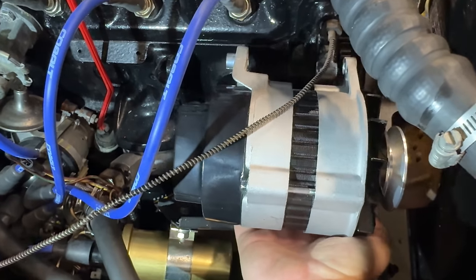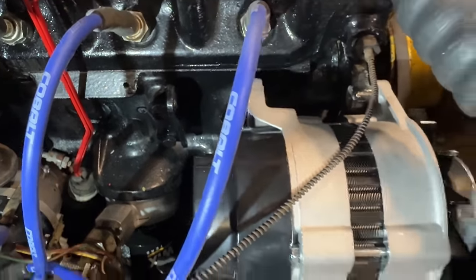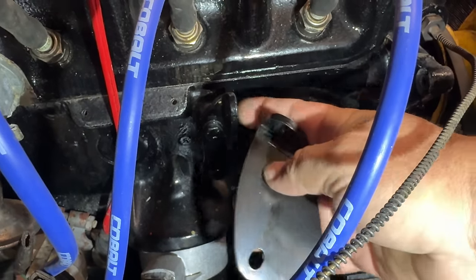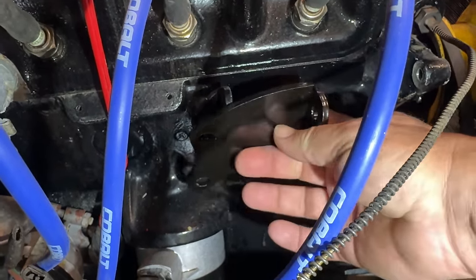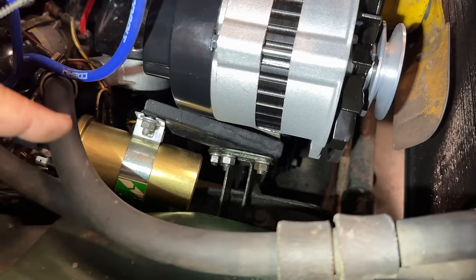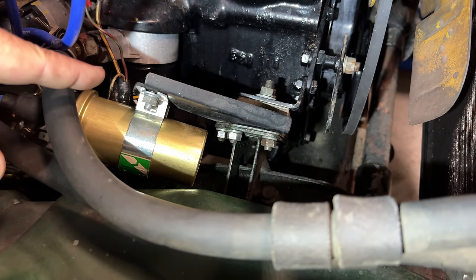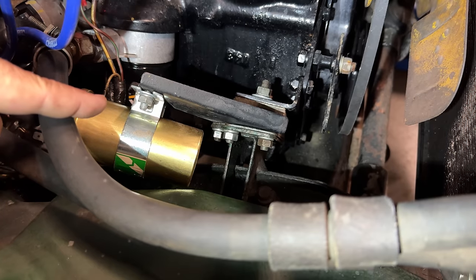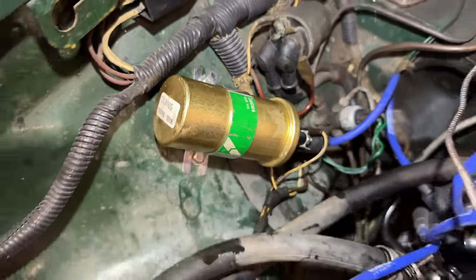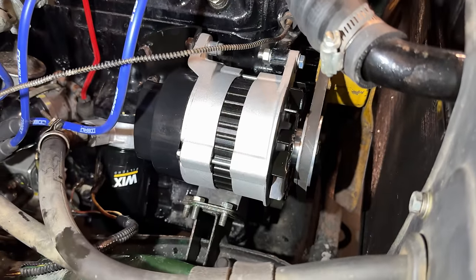If we hold the alternator up where the generator was, you can see that we are going to be using the same front bracket, but the rear bracket is way back here. The kit comes with a new bracket that will take away that gap, so we will be taking this bracket off and replacing it with this one that brings this tab way over. Now with that new bracket in place and the alternator mocked up, you can see that the alternator is going to be hitting the bracket for the ignition coil, so we're going to have to relocate the ignition coil up further onto the fender. It's just three bolts on the motor mount to remove the bracket for the ignition coil. I'll take the bracket off, put those bolts back in, and then unbolt the ignition coil from the bracket and remount it on the fender where it's out of the way of everything and leaves the wires long enough to still reach the distributor and the alternator. From that point, the alternator just bolts up like a standard generator.